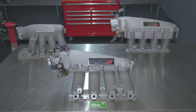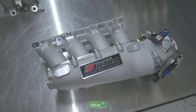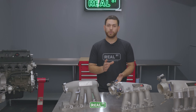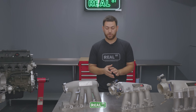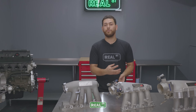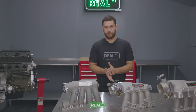From that point forward, we let our engine cool down and we switched over to the second manifold, which is the Ultra Street style manifold. This one's really cool because it is a two-piece design. It allows you to stack spacers if you'd like a little more plenum volume, but you can also still retain that OEM style bolt pattern for the throttle body. Since we're able to do that, same as the Pro Series, we went ahead and retrofitted that 74-millimeter throttle body onto this manifold as well to keep that as a constant between these two manifolds.